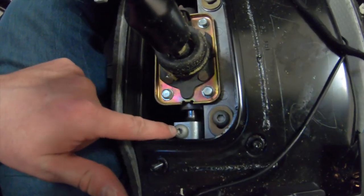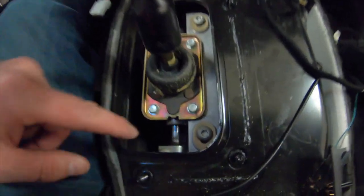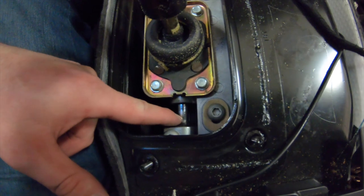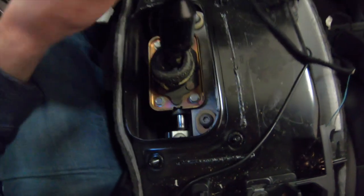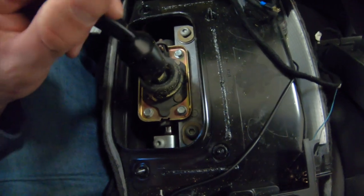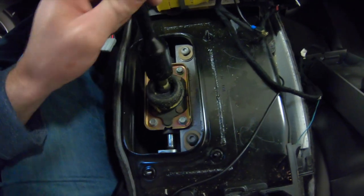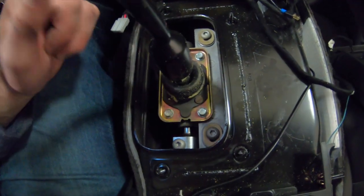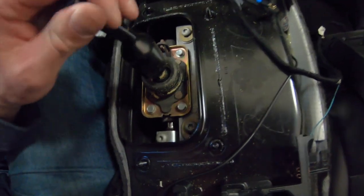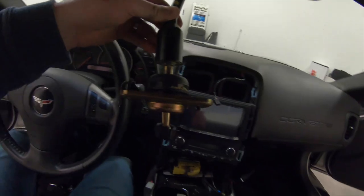So this is really where all the action is — you can see the actuation of the shifter there. Earlier I kind of misspoke when I said shift forks — there's basically a little shift rod here. This rod spins one way or the other and goes back and forth, and basically the mixture of it turning and going forward or back puts it in whatever gear we are selecting.